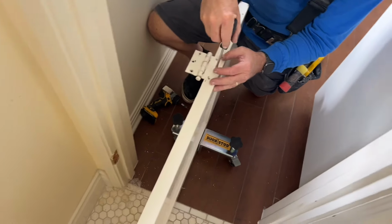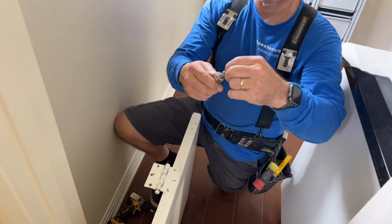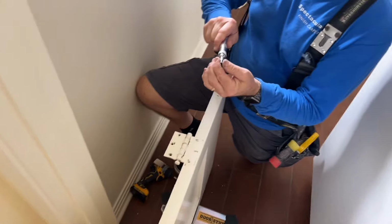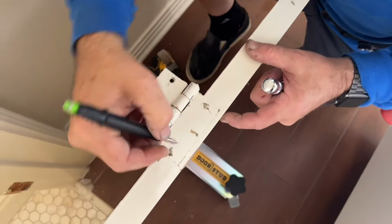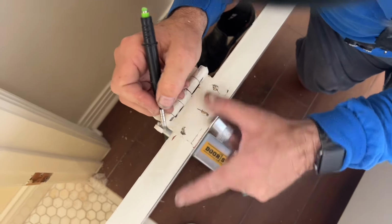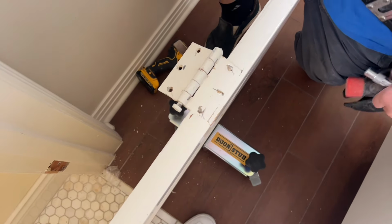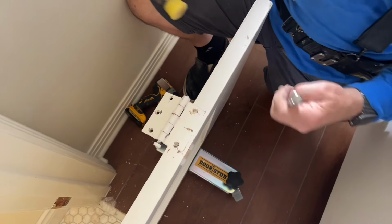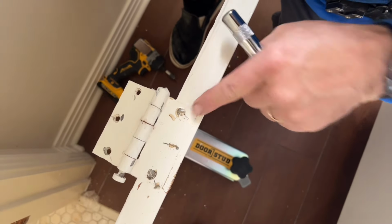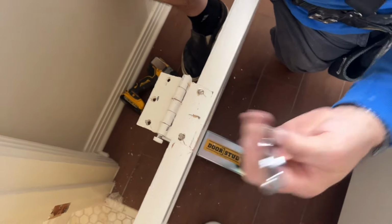Once you've got that, you use an impact tool, which you can pick up at an auto parts store. This is, again, a spring-loaded tool. You can slide in different tips. I'm using a fairly small flat screw bit, and I'm also marking where the screw slot is when I start. That way, as I hit it, I can see if I'm getting it to move. So I put it down there and use a mallet on it. You could use a hammer or a mallet, it doesn't really matter, but you'll see one hit and I'm starting to see it move already.